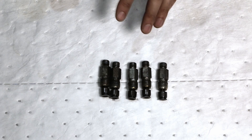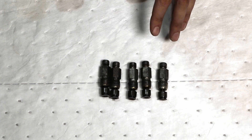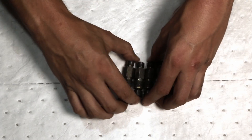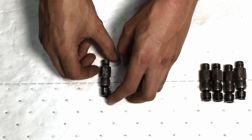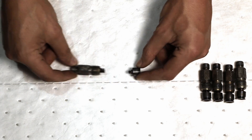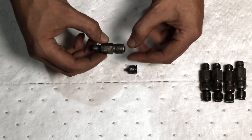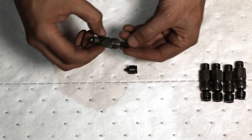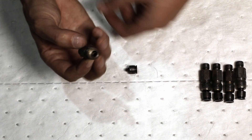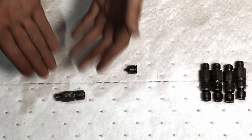I've already got my replacement ones in, but I can show you what a good delivery valve does versus what a bad delivery valve does. First thing we want to do is separate these into their components. This right here is the delivery valve. This is the delivery valve holder, which has a spring in it, and other than that it is basically just a straight-through tube whose purpose is to hold the delivery valve in place — thus its name, delivery valve holder.